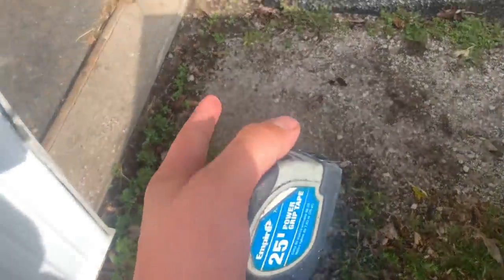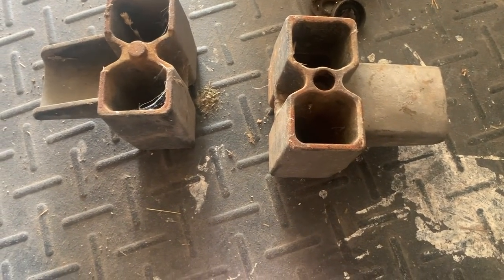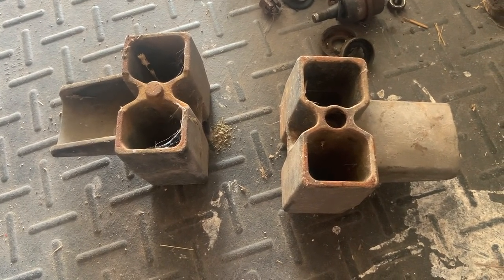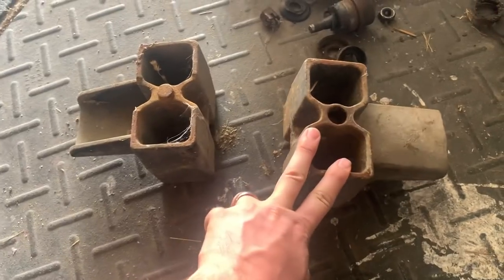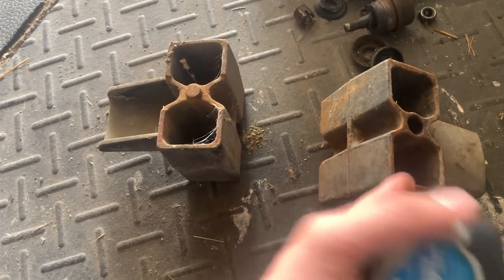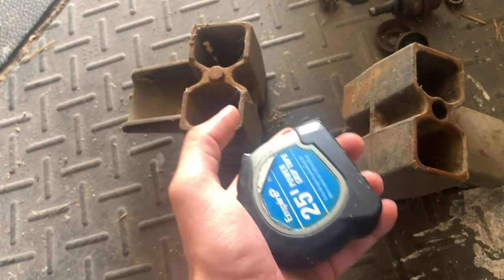I was thinking, I don't like the look of that, so I wonder if I've got some. And I actually happen to find some, and these are factory 5-inch blocks for a second gen in the rear, and I'm gonna be trying to put these on the truck today, and I don't think it'll be too terribly difficult, knock on wood. I think this would definitely help with the rear end of that truck and make it look a lot better. There's nothing wrong with these. We just took them off another second gen 2500 because we did a lift kit on one, and then you take off the factory block and put a bigger block on the back.